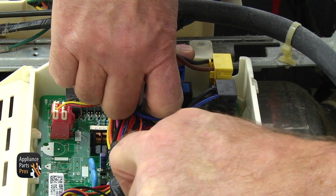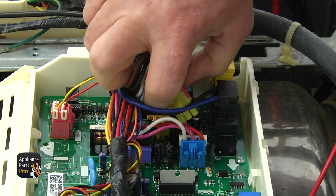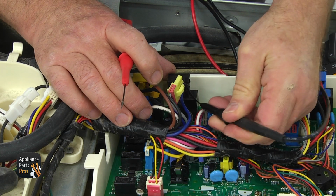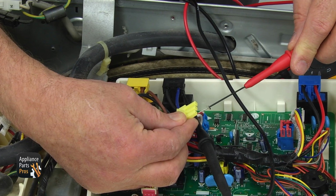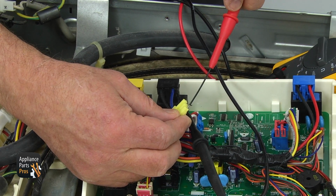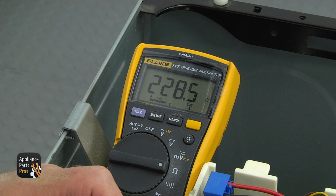Unplug the black relay and yellow YL3 plug, and touch with meter probes the blue wire at the relay and number 3 gray or black wire at the YL3. You should read between 50 and 800 ohms. If the reading is way off or there is an open circuit, the igniter is doomed.